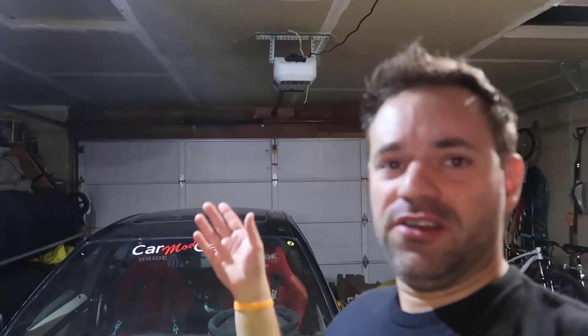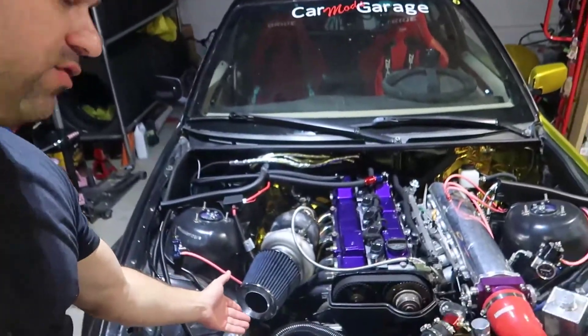After fixing the VVTI wiring, TunerStudio stopped resetting. However, the car doesn't run smoothly with VVTI plugged in, so for now it's unplugged. I still want to use it because VVTI can give 30-40 extra horsepower in the lower RPM band, which will help spool the turbo faster. I hope this helps — I couldn't find any detailed information about sync loss like this online.